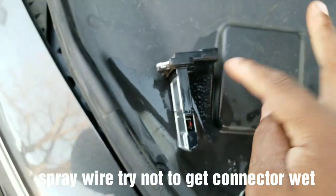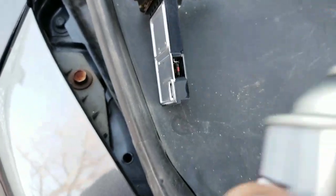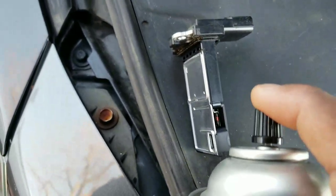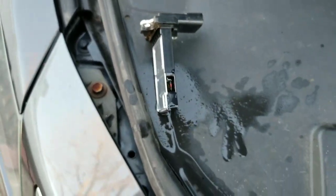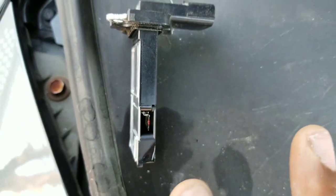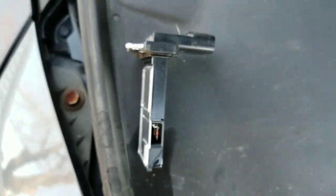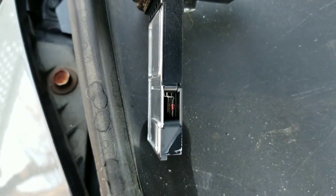Don't let it get up to the top where the sensor is — it dries right away. When you spray it, you're spraying it on the tabs, and then you just let it dry. That's it. You don't have to touch anything, don't wipe anything, and don't touch these wires — they're very, very sensitive and you can mess up the sensor that way.